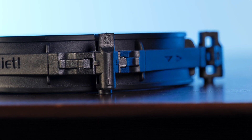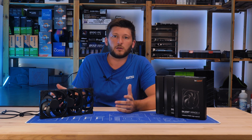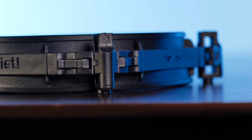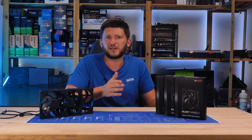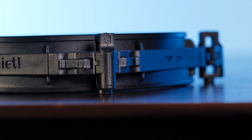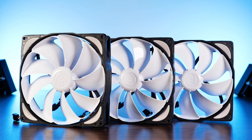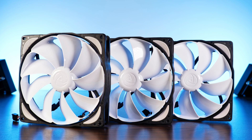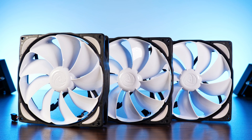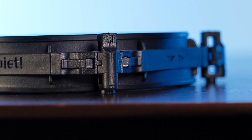The pushpin edge system is reversible, but the two sides are not identical. One is marked with an S and the other with an L. The L side has a tiny piece of rubber sticking out, meaning that if you install the fan in the back with the L side going behind the fan, you end up with a very tiny gap between the fan and the case. By reversing those, you take away that gap and make it completely stick to the mesh filter. Although the gap won't change anything performance-wise, it can do a lot regarding noise — certain combinations of fan blade design and mesh filter can produce horrible sound, like Noise Blocker fans and basically any mesh structure. So if you experience horrible sound, make sure to have that gap in between; otherwise, don't worry about it.